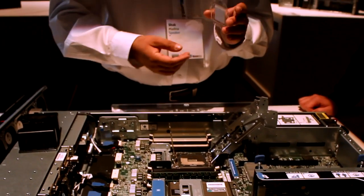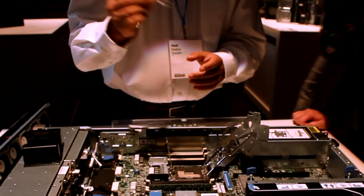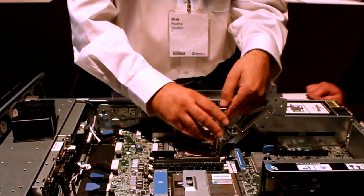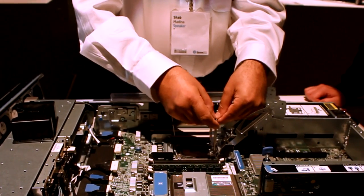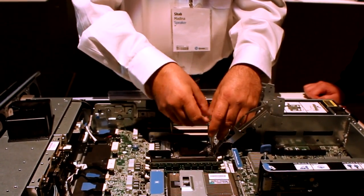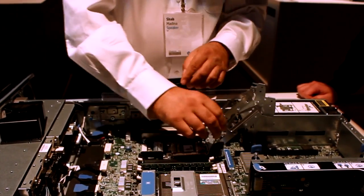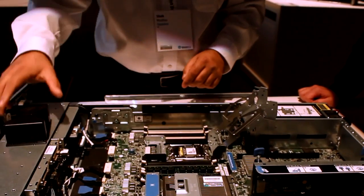The critical thing is that when CPU pins get misaligned, you may not even know about it — your server will still come up and errors may develop over time. That makes it extremely hard to debug because you may not even tie the issue back to that event. We've done as much as possible to make it very difficult to bend pins on a CPU.